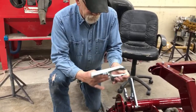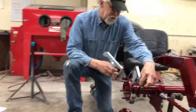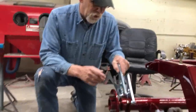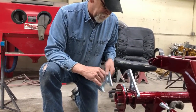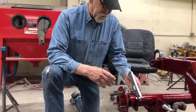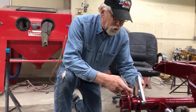It could fit the other way, which would be backwards. You can see the little spacers on the kit right here — if I put the other side on it would make it too close, and what will happen is the caliper won't sit centered in the rotor. It's about as basic as a person can get. There's three bolts — one, two, three — goes on where the backing plate bolts were.